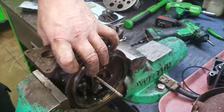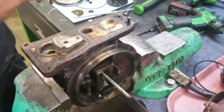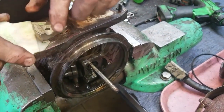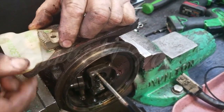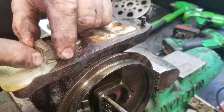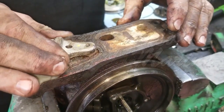Now that we are repositioning the center cartridge in the vise, the next step is to use a special tool — a specific tool for this specific turbo — which helps ensure the proper depth of the VGT actuator gear shaft compared to the housing. We are also going to check for proper and full range of motion of this gear.